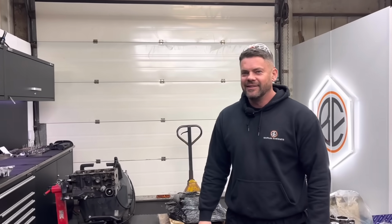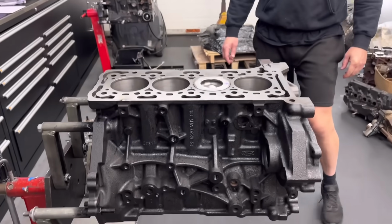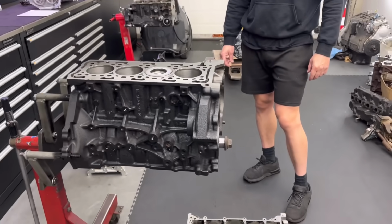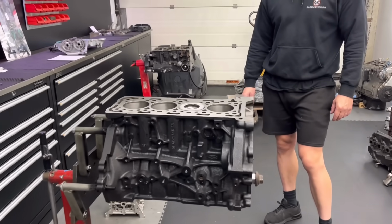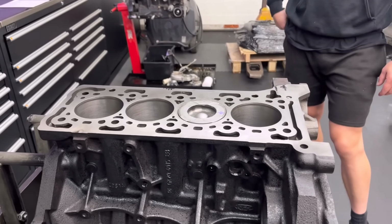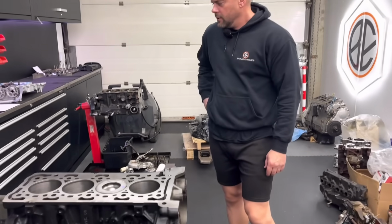And you have been cracking on in between, doing crap stud removing jobs, mate. Helicoils and stuff. I've been cracking on with this. So I've got it all cleaned and painted up. Wet belt Transit. Nice. Bores are cleaned up nice, I see. Yeah, they cleaned up nice. Took about half a thou out of those. Yeah. So that was all right.